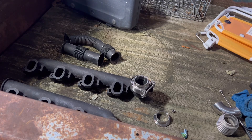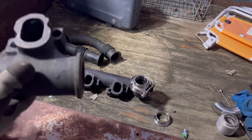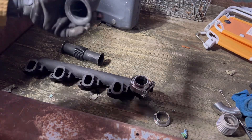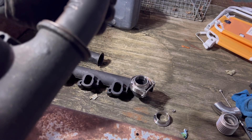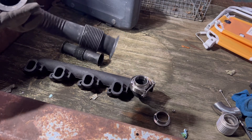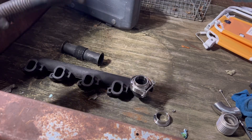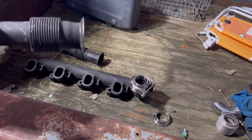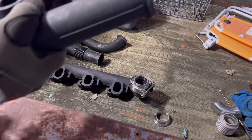We've got our van slash hummer manifolds here. You can see they kind of already have a factory-ish V-band that goes on them. They're kind of a bastard flange — they're like an 87 degree flange, is what I heard. Anyways, they're terrible. These are double wall pipe stock up pipes, basically air gap, and they're very thin. I don't think I'd trust these trying to put 500 horsepower through them, which is what we're going to try to do. You can see these are bellowed just like a Duramax up pipe, but they just aren't going to quite cut the mustard.